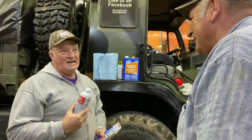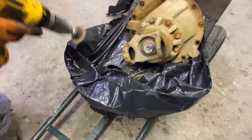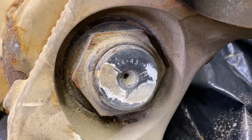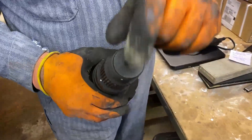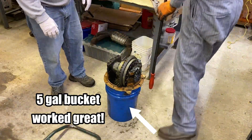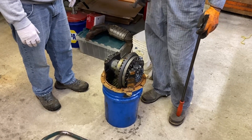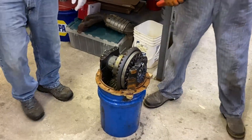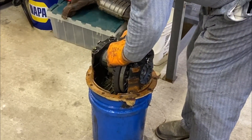I also got some Sea Foam. Our tooth count is 14 and 43. We can look at this gear set — it says 14 and 43, which is a 3.07 ratio. This allows us to check the backlash where it's sitting, make it convenient to work on, and then put it back in and duplicate the same backlash. The backlash is the clearance between this gear and that gear.